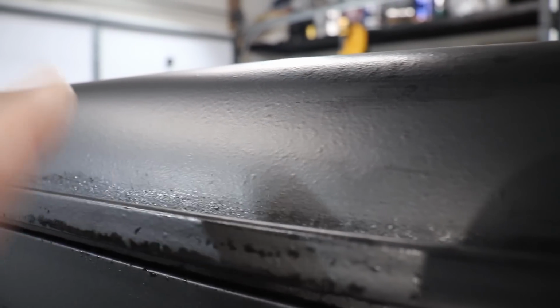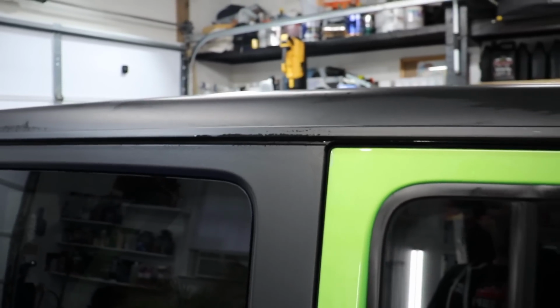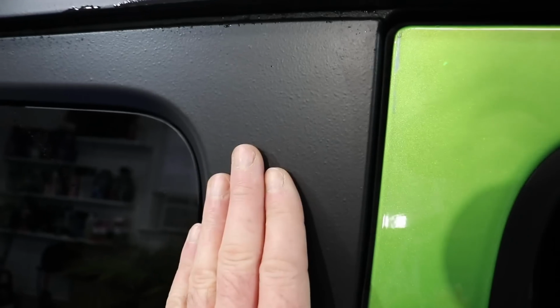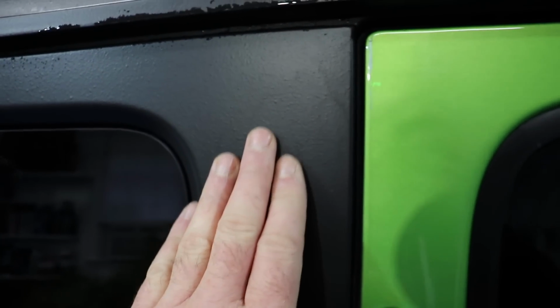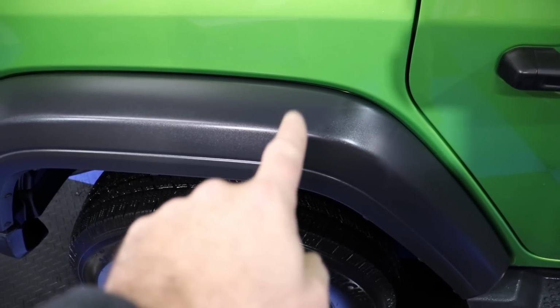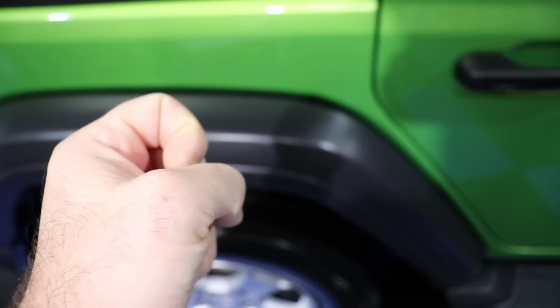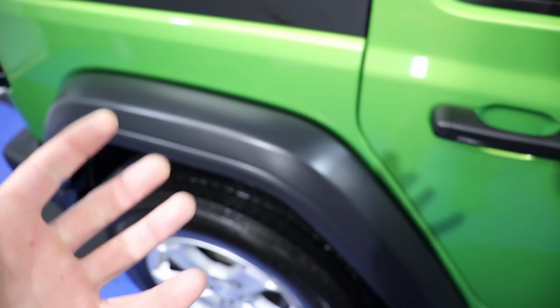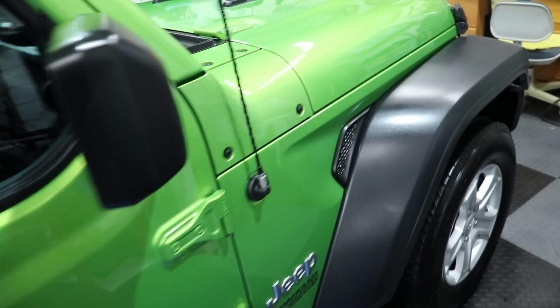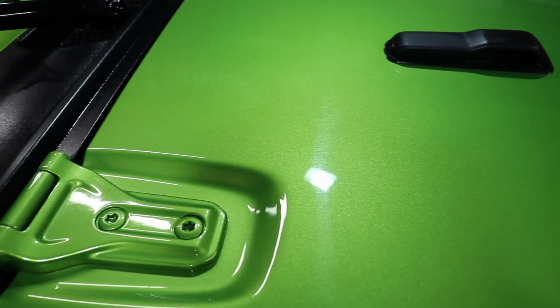It already is starting to dry down and look really nice. So it will add protection, and it'll bead water, but it's not going to add any shine to it. So we're not shining this up with the trim shine. This is painted. That's different. You can use a spray sealant or even a spray wax on there, because it's not going to really increase the gloss. But this is a different material altogether. It's textured plastic that absorbs it, and it's meant to be kind of a satin finish. Some like it shiny, but it's going to end up more of a satin finish. But man, this color is beautiful. I love it. I just wish we could polish it and coat it with a true coating.